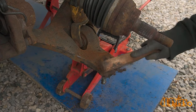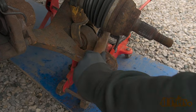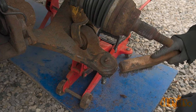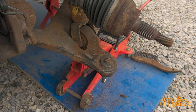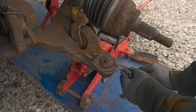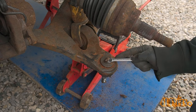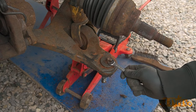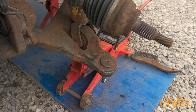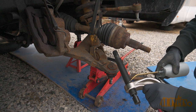Using a wire brush, clean up around the pressed-in ball joint. This will remove any debris so we can determine if there is a clip required to be removed, and no debris will bind up when removing the ball joint. Using snap ring pliers, remove the snap ring. Rust can sometimes hold these snap rings in place, so the assistance of a standard screwdriver may be required. Considering this is a serviceable ball joint, the grease fitting will need to be removed. With this removed, we have a flat surface for the press to push on.